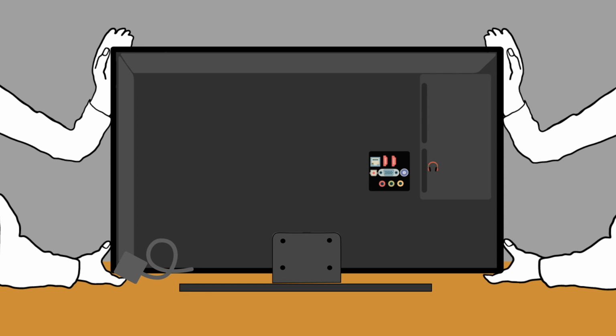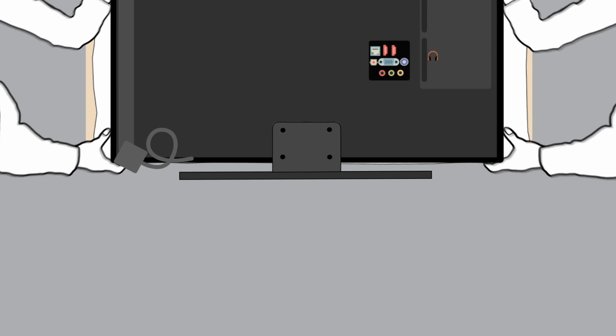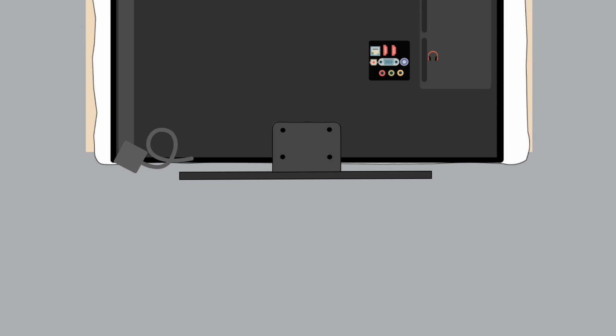Ensure the plug is secured safely to the back of the TV. Lay the protective bag on a tabletop to protect your TV. If the stand is fitted, this will need to be removed. Lay the TV on a table so the edge slightly overhangs the edge and unscrew the 4 half-threaded screws with a Phillips screwdriver. Slide the stand out from under the lip. You can refit the 4 half-threaded screws back so they are not lost.